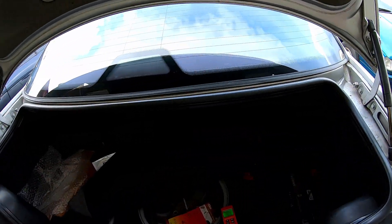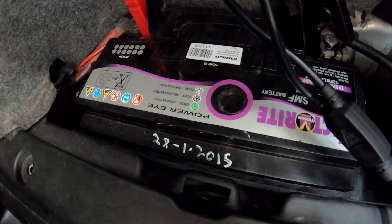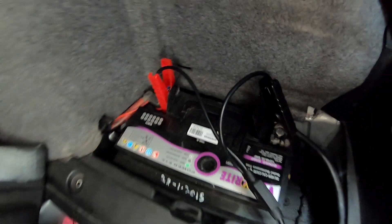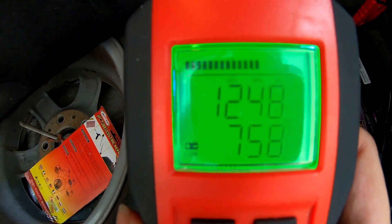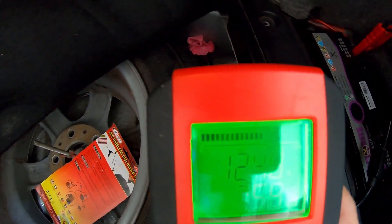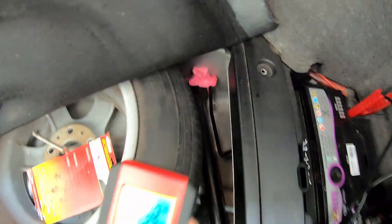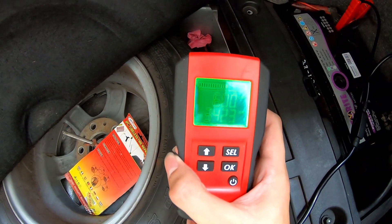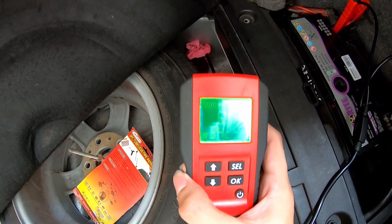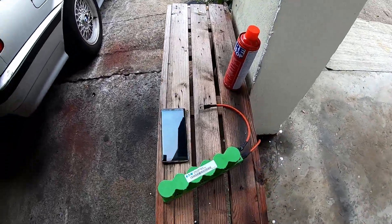On my E36, it is a used car and the battery is more than four years old — coming to five years old soon. I did a CCA test. The machine is showing me a low battery warning because the battery is supposed to have somewhere about 635 cold cranking amperes, but it now only has 342.3. So let's see whether I can use the supercapacitor to boost the CCA and extend the lifetime of my battery.